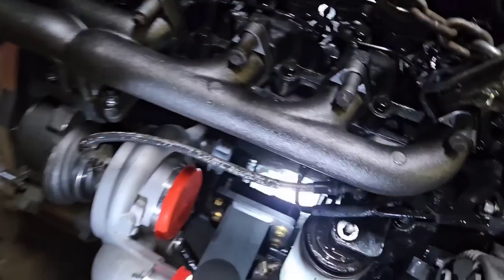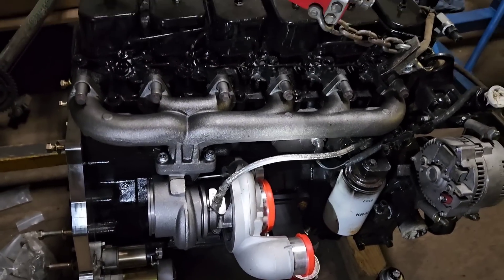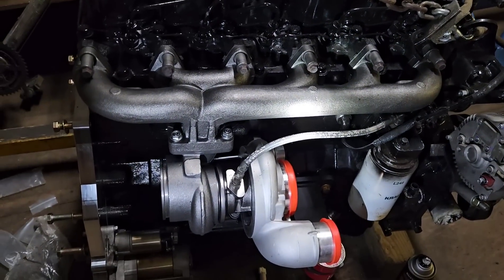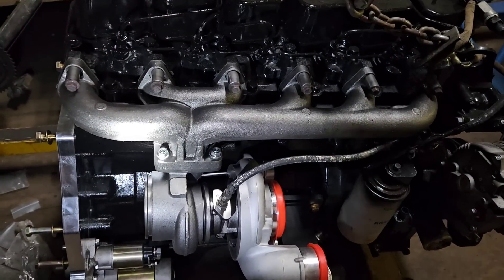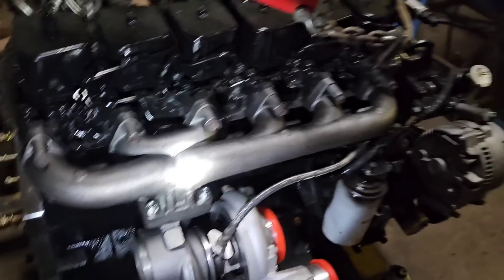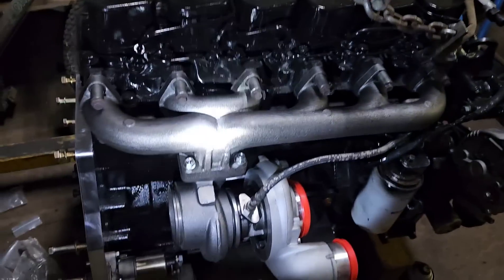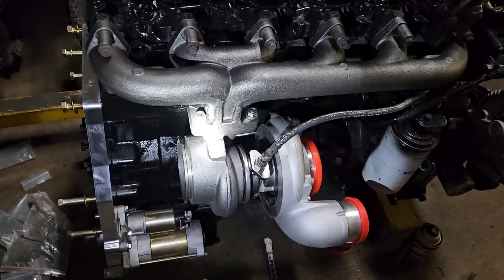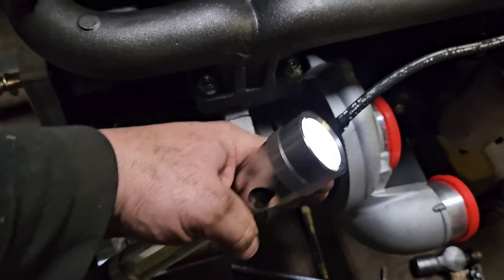This is the updated one — this is the third gen. Like I was showing before on the whiteboard, the 2003 to 2006 common rail exhaust manifold. You can buy these online, they're not expensive. And you need that because instead of coming down off the side and pointing outside, this one points downwards and at the back. Which is great because the air box is right here now. So now we're clear of everything.